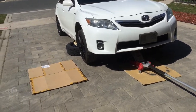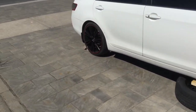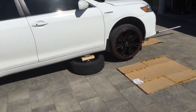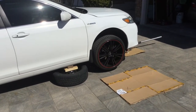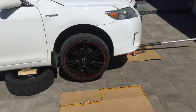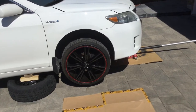The interlocking stones go behind the vehicle to protect it from rolling back, right underneath the tires. The winter tires go in on the front of the vehicle with wooden blocks to support the weight of the car in case the jack tries to play some games with us. We're doing this to avoid taking off the tires and coming through the front of the vehicle.